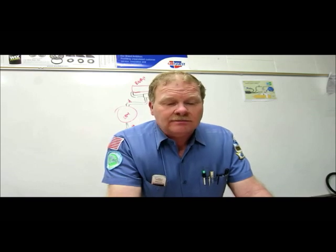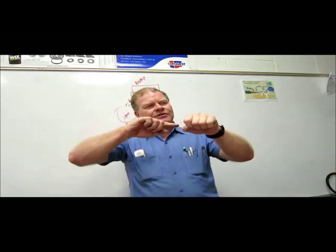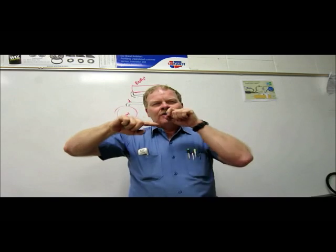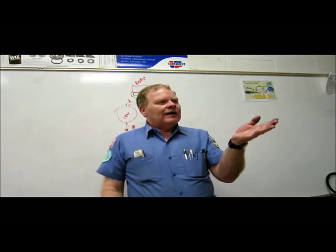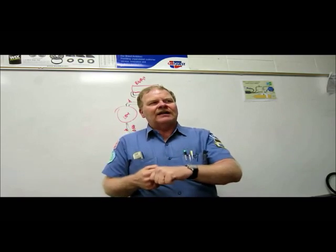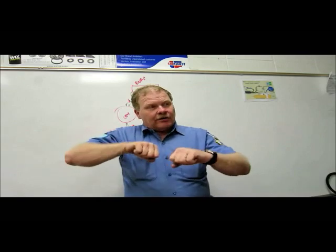Well, sometimes you'll see silly, stupid, second-rate, half-wit answers. Impact screwdriver, have you ever seen one? It's a thing that you've got a screwdriver bit on the end of, and when you hit it, it turns. It's really for breaking loose really tight screws. When you whack it, it's spring-loaded so that it turns. Almost nobody's got one of those, but they work really good. Have you ever been trying to take a brake rotor off of a car and you got them stupid big screws in there and you can't break them loose? Those are really handy for that. If you whack that sucker good and hard, it actually turns when you hit it.